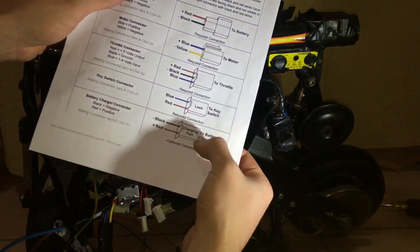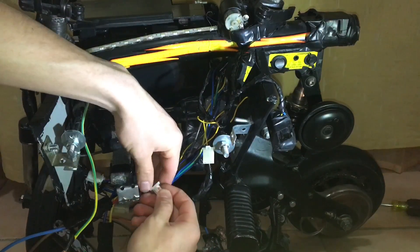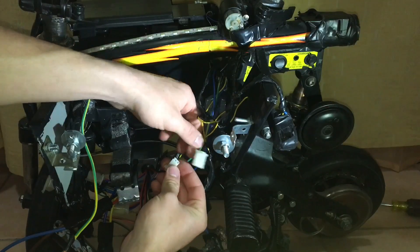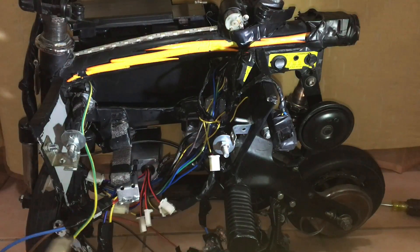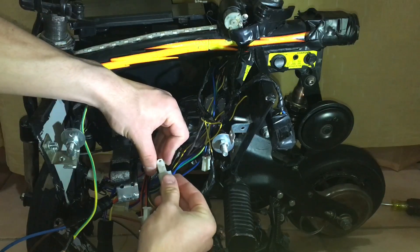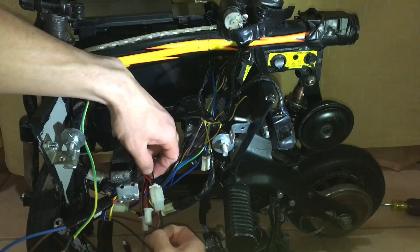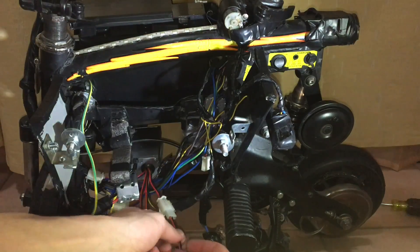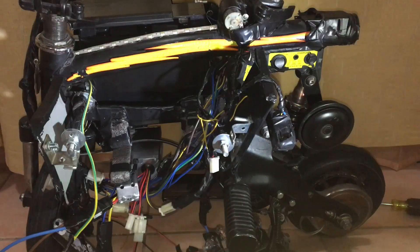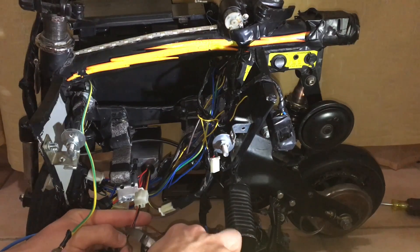Now I want to connect the charging port cable and it does have a labeled sticker on it so you can tell that it is the charging port cable. It is a 2 pin male type connector and my scooter has a 3 pin connector but with only 2 pins inside, however it is the same male type connector. Since I don't have any more 2 pin connectors, I'm going to replace the 3 pin male type connector with a 3 pin female type connector from the old speed controller, and then slide the 2 pin male type connector into it. It is absolutely critical to make sure that the red wire connects to the red wire and the black wire connects to the black wire between the two connectors.